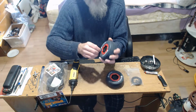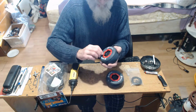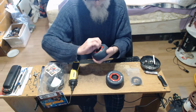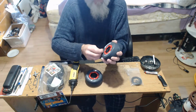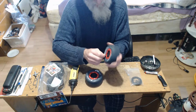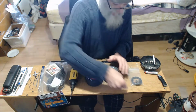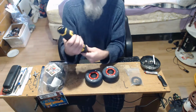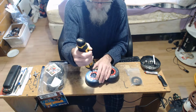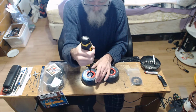Whenever you use an electric driver, it's always a wise choice to get your bolts started or loosened by hand before you grab the drivers and go to them. A lot of times these drivers have improper torque settings, so you strip holes out, you strip ends out. So it's wise to use a hand wrench to get your nuts or bolts either tight or loose. And then once they're loosened up, then just go. Sure saves a lot of time this way.